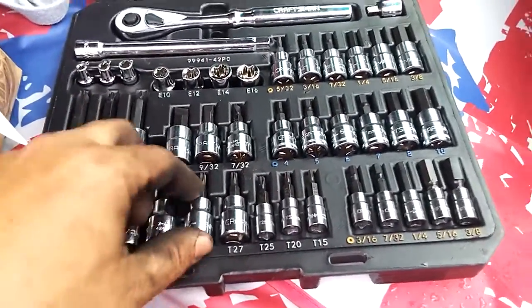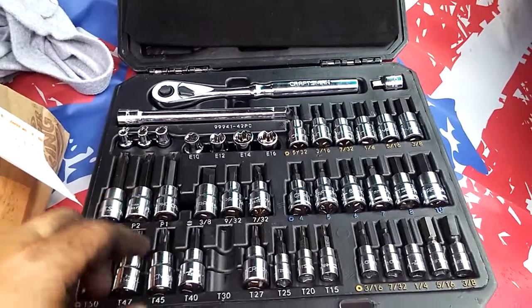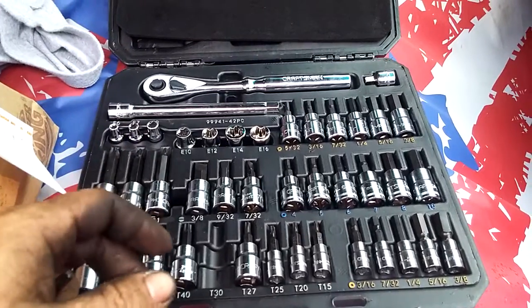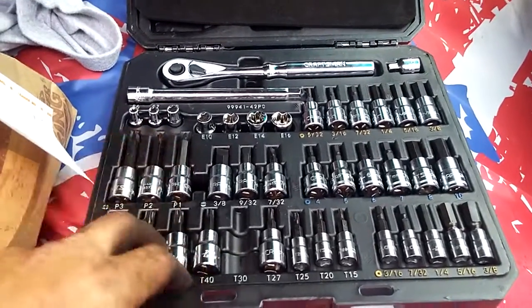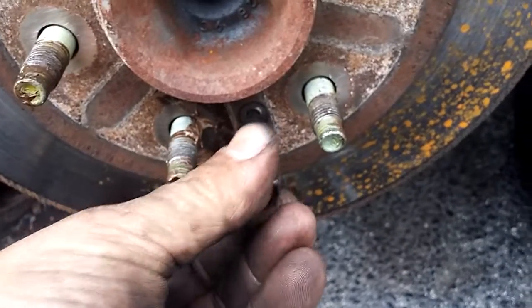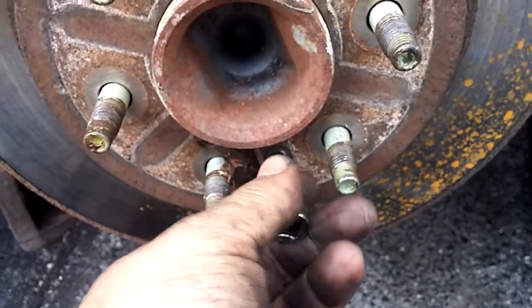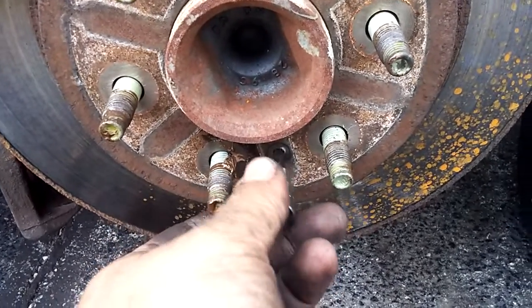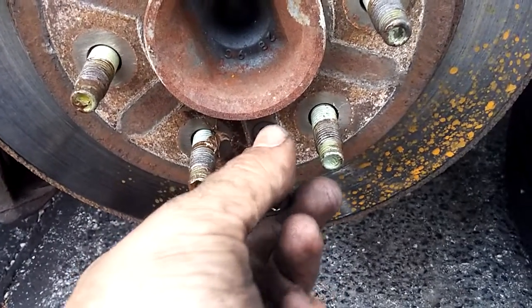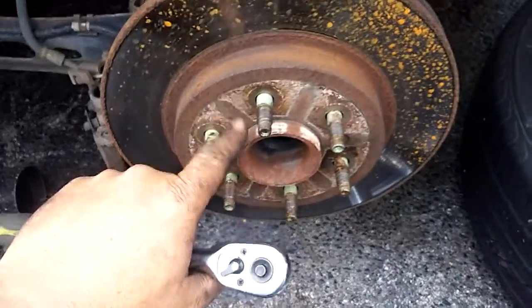Come over here and get one of our Torx bits — it's going to be a T30. This nice little set is usually $100 but on sale at Sears for $30, sometimes $20 with a coupon — links in the description box below. Slide it in there to make sure it's nice and snug, fits good and tight. Now I'm going to want to spray some Deep Creep, WD-40, PB Blaster — some kind of lubricant to lube it up a little bit before we try to get it off.